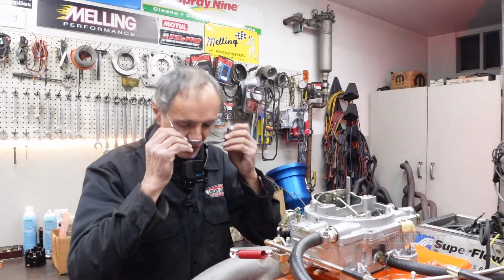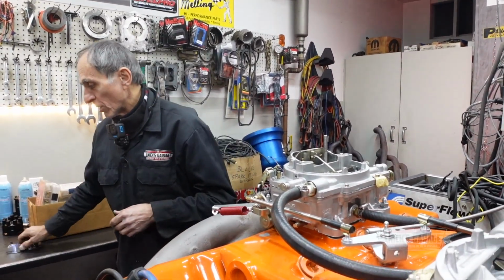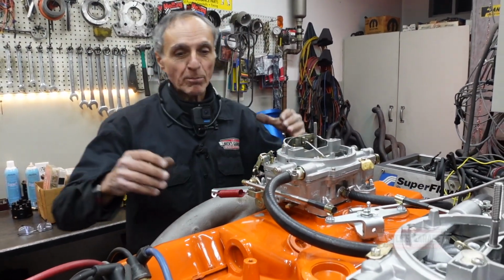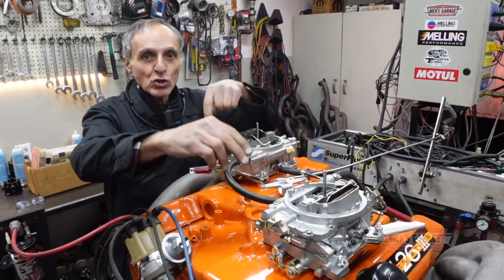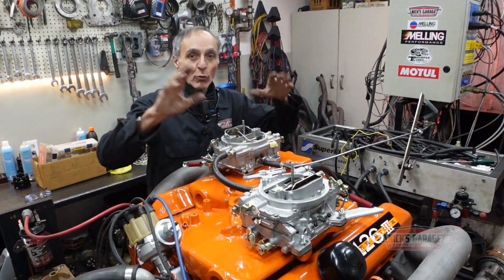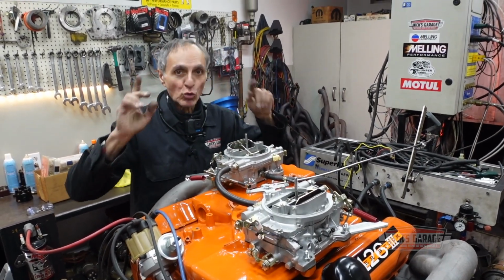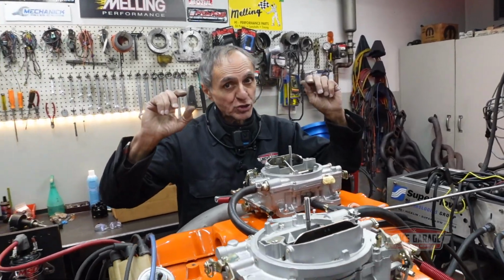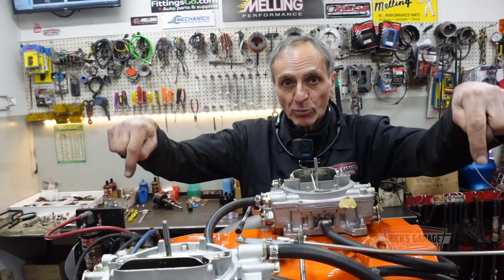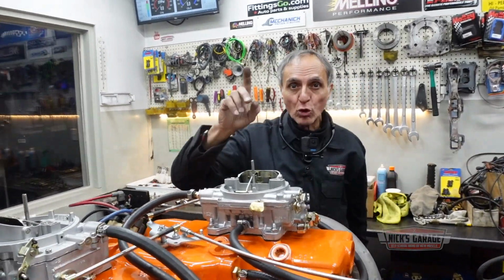And another thing I wanted to say, a lot of guys are commenting on the bolts. Yes, the bolts from the front going to the rear, they start at 2 inch, 2 1/4, 2 1/2, with the lock washers also lubricated. They're installed like that. The only two bolts I changed to a little bit shorter were the two external bolts that I did not like because they were too long.